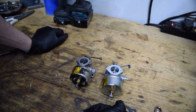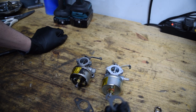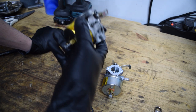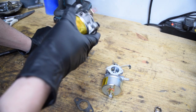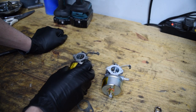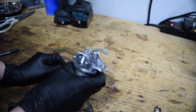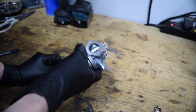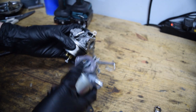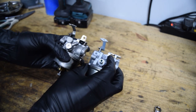That was a waste of time. I ended up cutting out probably 100 pull starts that didn't even try to start, and I left the ones where it sputtered or attempted. I've come to the conclusion that this carb is trash. I sort of rebuilt it - cleaned it and resealed it - but it still leaks and it floods the engine pretty quickly. This carb's not going to do it for us. And on top of that, a new carb is $8. When I was looking for carbs, I tried to find one that was four to five horsepower and under - this one is supposedly between three and five horse, which should be a better fit versus the one for six and a half horse. I also tried to pick one with an adjustable choke and a fuel inlet that wasn't at a weird angle like the old one.